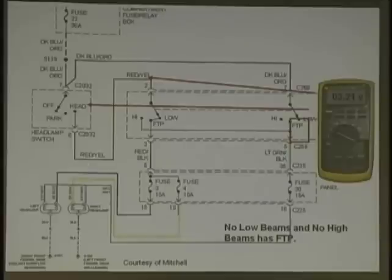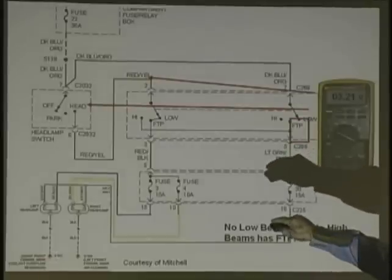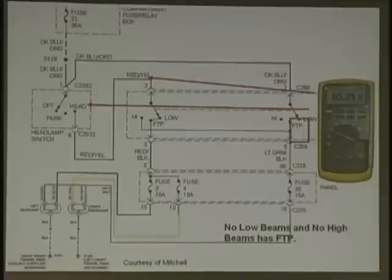Now another thing, notice on this headlight circuit that this has two separate grounds. How many of you come across the system that has one ground, has the two separate power feeds in, one headlight is bright, the other one is dim? Uses the same ground, can't be a ground. One single ground, two power sources. What's happening? Toyotas, Saturns. Connector at the headlight itself is resistance. Connectors are good. Two separate powers, one single ground. What's wrong?